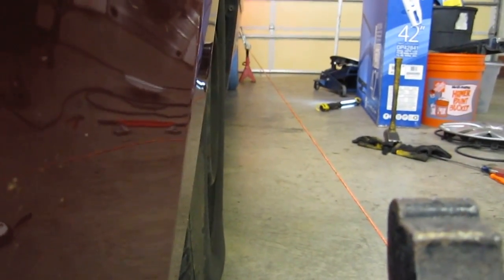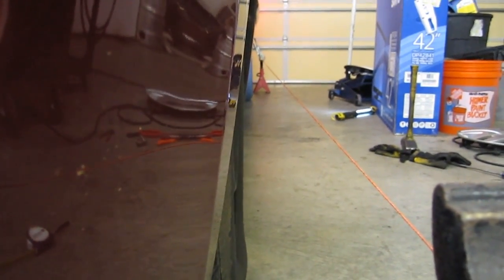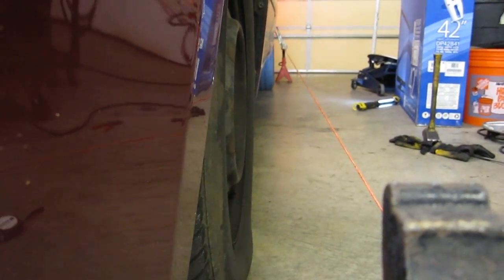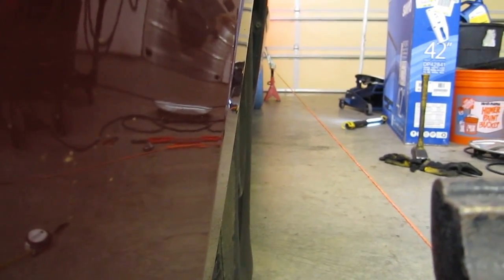Another thing you can do to get it reasonably close, and this was on Brian's mobile channel, and it works pretty well, is to eyeball these, and you can get it pretty close that way. You just eyeball the planes of the wheels until they eclipse each other, but the string is a little more exact, but definitely takes some more time. And with some body shapes, it's pretty hard to see the plane of the wheel, so that doesn't always work, but the string usually will work.